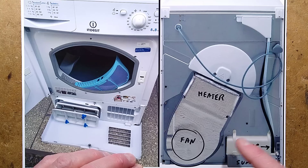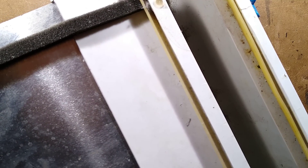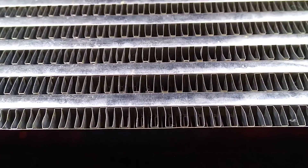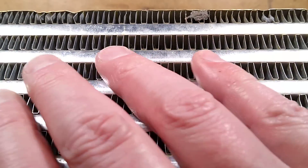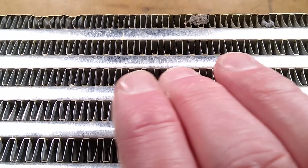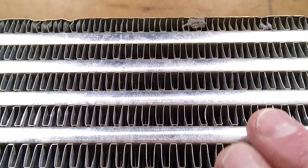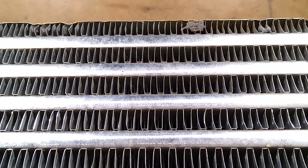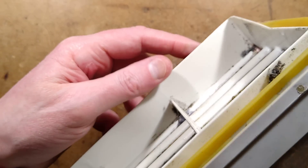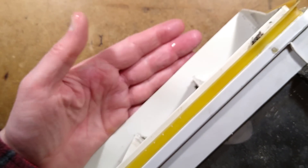Here's the condenser — it's big. Here's the air inlet into the condenser. The air goes from the lint filter in here and comes out the other side. This condenser has two separate paths: the cold air path that passes through these finned areas, and the hot air path which goes through these hollow channels from one side to the other. Room temperature air blows through the fins to keep those channels cool, while the hot air from the drum passes through the hollow channels. The water condenses out and, because the condenser is at a slight angle, it drips off into a collection sump at the back of the machine.